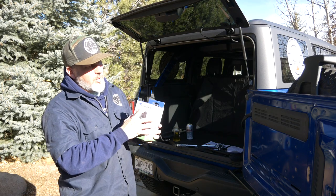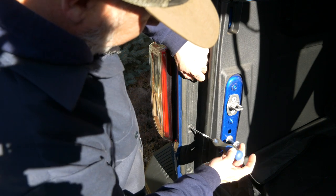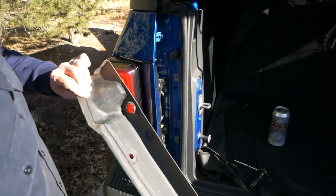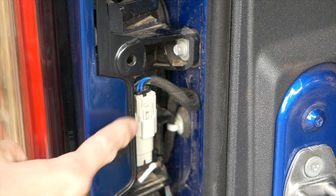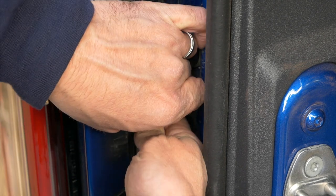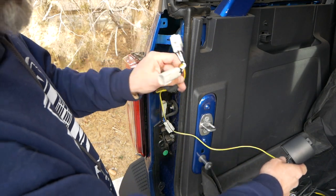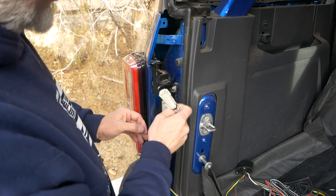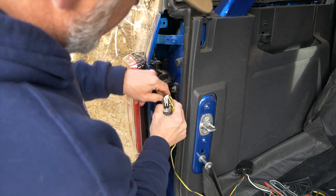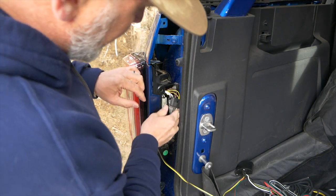You're going to remove this little plastic and rubber cover right here — the little plastic screws come out, and then two 10-millimeter bolts right here. Then you're just going to pull this cover right out just like that. The key to these connectors is you're going to push in on that tab, and sometimes you should hear it kind of pop when you push it in, meaning it's coming off, or feel it pop meaning it's coming unlocked, and then just pull up. Now we're going to start from the back. When you get your harness, pull your harness out — the yellow end with the yellow wire is going to go to the driver's side. You just plug the male into the female, turn it upside down, and plug it in just like the old one did. And then that one is installed.